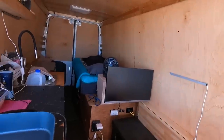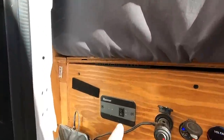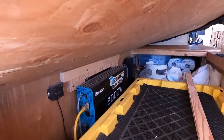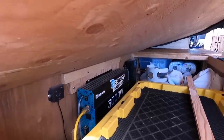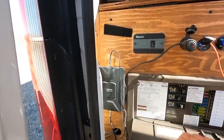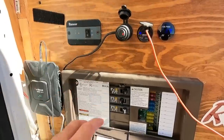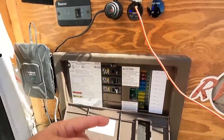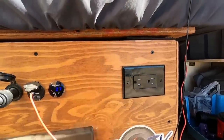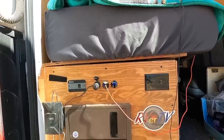Let me show you the panel. The inverter is off under here — there's the 3000-watt inverter, everything turned off. We'll be able to feed 110 volts. The van is set up to receive shore power. This 15-amp breaker stays off because that feeds voltage back to the house batteries. These two stay on: the main 30-amp coming in, and the 20-amp that feeds all the 110-volt plugs — that'll be live for the test.